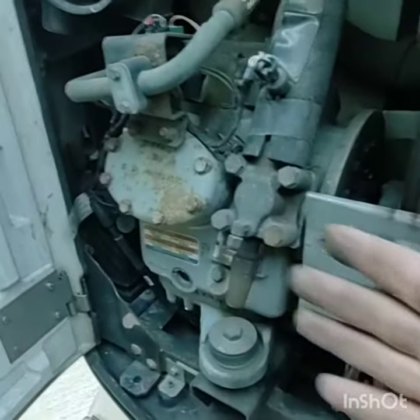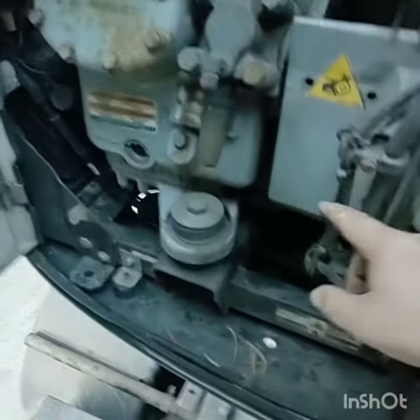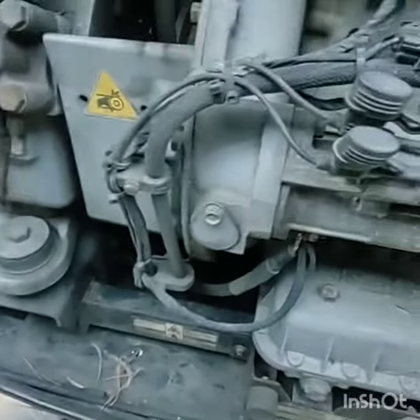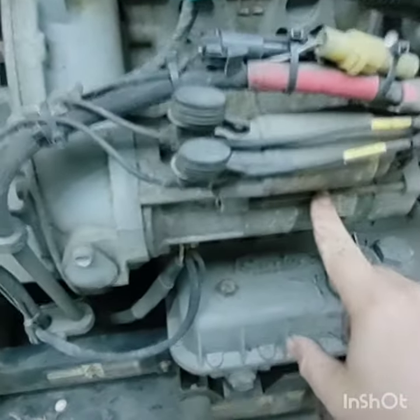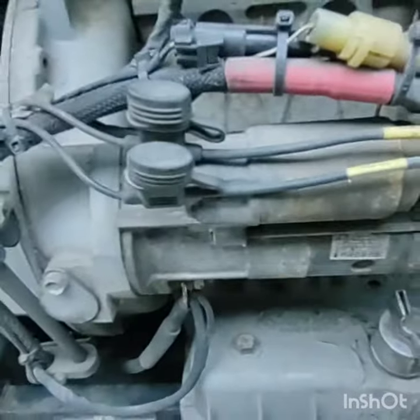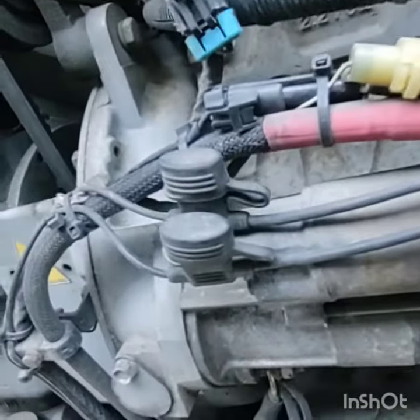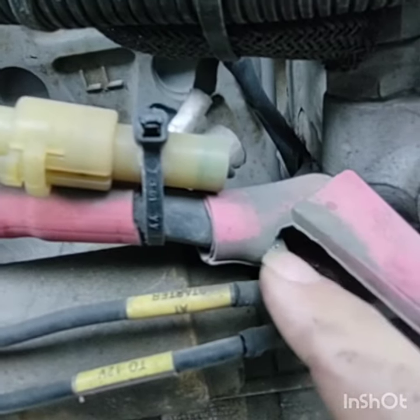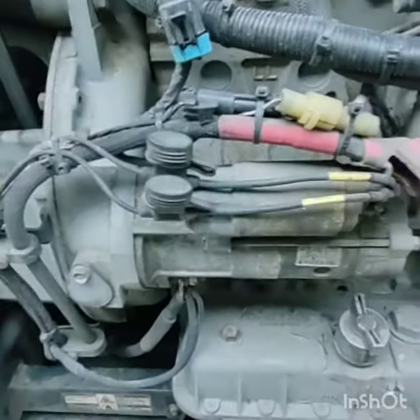Not to point out every single wire in here, but as you can see, you got wires running all over the place in here. Just give them a quick once-over — make sure nothing's rubbing, as that can cause you a problem later down the road. Right here you got your starter and solenoid — look up in here to see that you don't have a ton of corrosion on the connections. You can clean that up. We got a little bit of green right there — I'll clean that up one day.